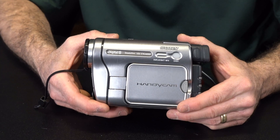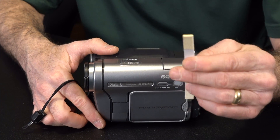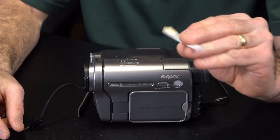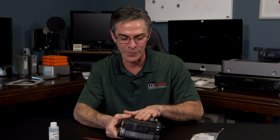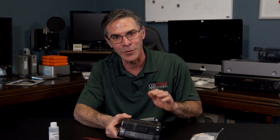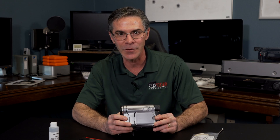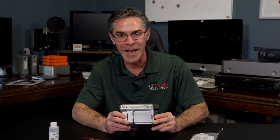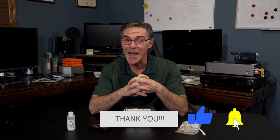And that is one clean Sony 8mm Handycam — it wasn't too bad. Now you most likely don't want to use that same tip again, so you can just take scissors and snip it off so you have the fresh side and put it back in your bag. Cleaning this unit wasn't too bad — there were only three little screws to take the faceplate off, and using the swab to get in there and clean things out. I think you're going to find it a lot easier, and you'll be able to see what I'm talking about when you do it yourself. Remember, I do have the swabs, the cleaning solution, and even a link to this camera in the video description so you can buy it and do it all yourself. Thank you so much for watching — I really appreciate it. If you have any further questions, don't hesitate to write them in the comment section. Please remember to subscribe, like, and ring that bell for future notifications. Have yourself a wonderful day.